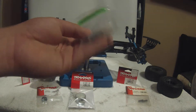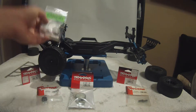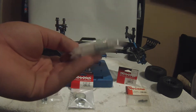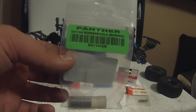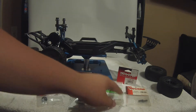Third thing are the Panther bearings. These go in your front and rear hubs as well as your transmission. These were $10 for 10 bearings, so a dollar a piece — about half the price of Traxxas bearings which are two dollars each. Part number is B51141, and it will be in the description.